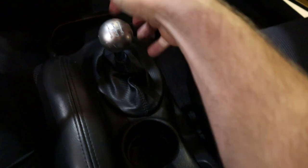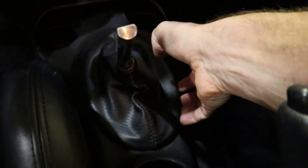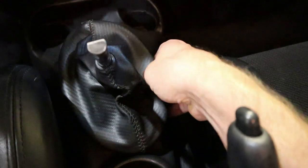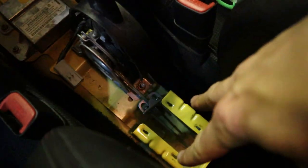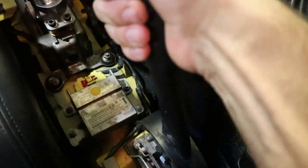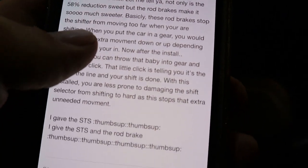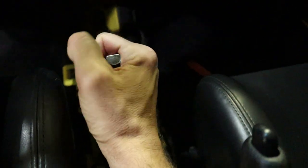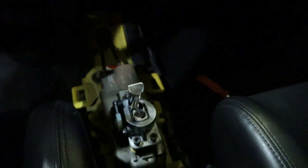To get the shift knob off, I think it's just second gear — got it. I think this pops out. I just pushed on the side and it popped out back and front. Console is super easy to pull out: four screws in the back, two up here in the cup holders. Just make sure your e-brake is super high, slip it up from the back and out. Turns out there's a Mad Dog STS Rod Brake on here — apparently it's something that makes the shifter really click in. This thing is like a bolt-action rifle. Tight little gearbox for sure.